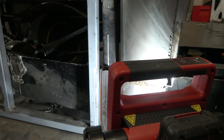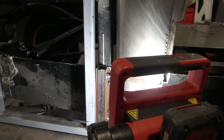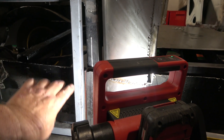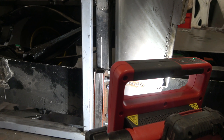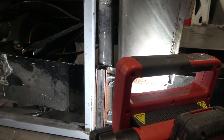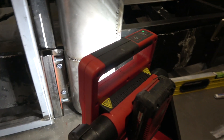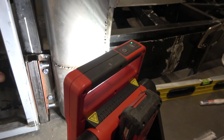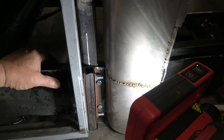I need to bring it forward about 4-5mm. So I'm going to have to chunk 4-5mm out of that and then put a fascia on it afterwards — it's the only way I can do it unfortunately. Because that was really hard to get through that chassis. On the back bit, obviously when they made these back in those days they obviously couldn't extrude the steel — they didn't have the technology.